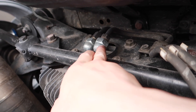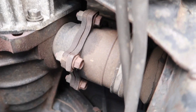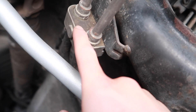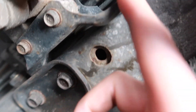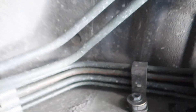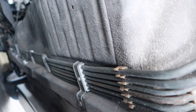Here's where the OEM HICAS bar was — we deleted that, plugged the line as mentioned. What we'll do is take off this bracket here, it's probably a 10 millimeter. Follow the lines over, hit this bracket and get it loose, then loosen up this bracket here. We'll take out this module and the brackets — got one there, probably one on the other side. Follow the lines all the way down and remove them accordingly.